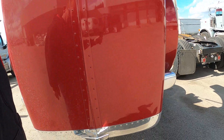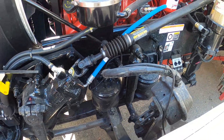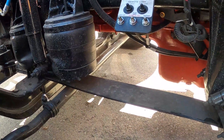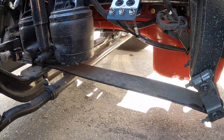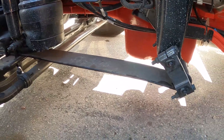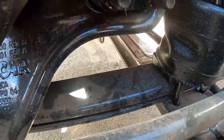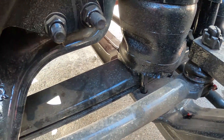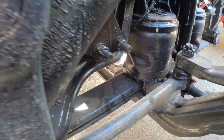With this thing aired down, look at how low the hood is — that's just crazy. This is our 13.2 front air ride suspension from Peterbilt. You'll notice it's got just a little skinny leaf on the back and it's basically just keeping everything in alignment. It doesn't really serve much of a spring purpose other than holding it together. We've got the two airbags, and on the front you can see the heavy spring. So if you do run out of air, that is the spring that holds everything. There are bumpers in there. Right now the truck is deflated, so it's sitting down.